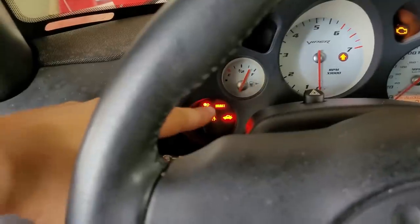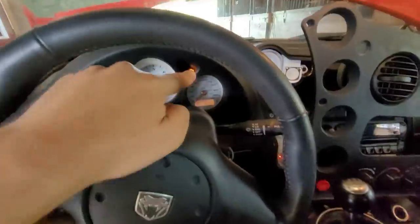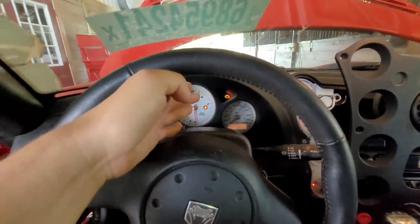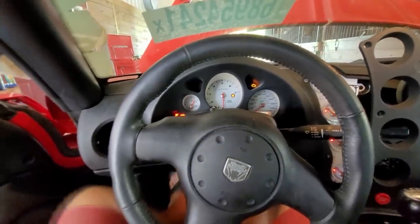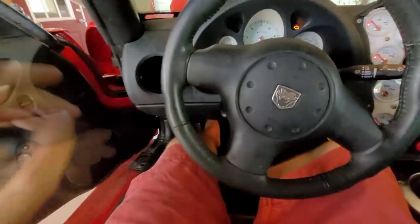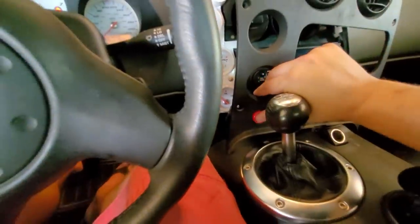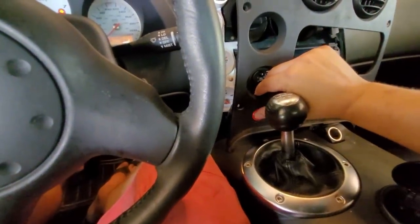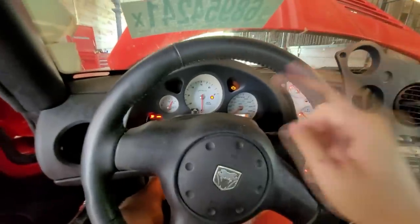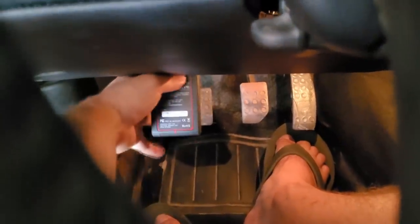With the keys in the ignition, some lights come on and go off. We've got the brights, the ABS light, the brake light indicating the parking brake is up, and a check engine light — that's okay, it usually goes away when the car starts. A lot of you mentioned the clutch switch: in manual transmission cars you need to depress the clutch before starting. Key on, clutch pressed — absolutely nothing happens. Next I want to plug in the diagnostic code reader to see if it even responds.